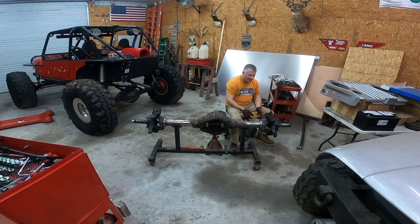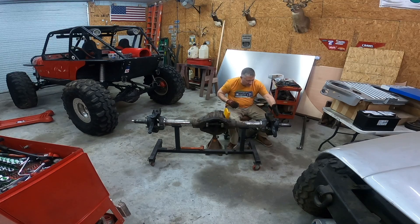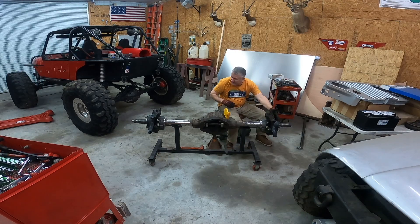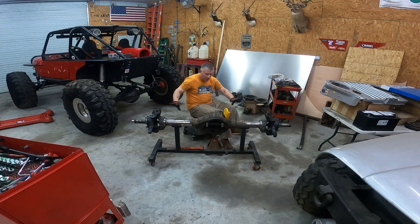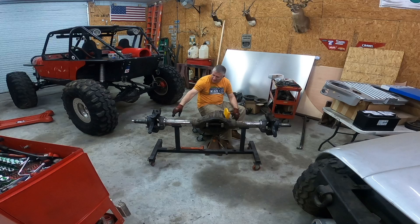The other measurement I had to do was to go from end to end — it's 59 inches on the front axle and I've got it right at 59 inches on this axle. So once I start welding this in and put a few tacks on to hold it in place, I think we should be good. This should be the same width as the front axle, and the caster should be set pretty well.